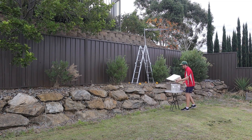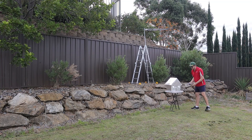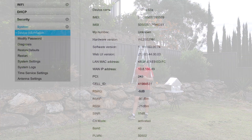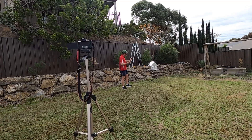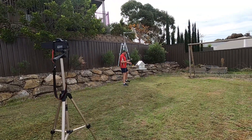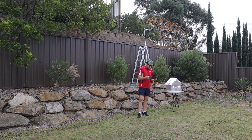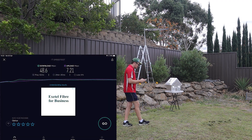I'm putting the roof on the outdoor housing — so it's shielded and a bit more protected. Let's see the actual signal strength. RSRQ is minus 6, RSRP minus 97, signal-to-noise is 11 dB, and we're on Band 40. I'm going to leave this as is — this is my baseline for this test. Running a speedtest.net: 48.6 Mbps download, 7.2 Mbps upload.